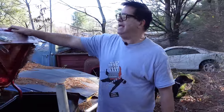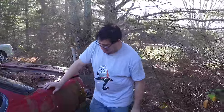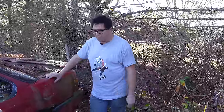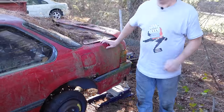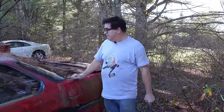The four-wheel steer was an extra-cost option, and about 30% of all Prelude buyers took it. Here we have it on this 1989 Prelude SI four-wheel steer. These Preludes are getting to be pretty collectible. Four-wheel disc brakes on all of them — sporty little cars, strictly two-doors. The Prelude was sort of a smaller version of the Accord, but a great little car in many ways. This one has probably seen its last days — it's a New England car with some rust — but the entire four-wheel steer system is still here. Maybe on a future video we'll put this thing on its side and take a closer look at how that driveshaft feeds steering inputs from the front rack to the rear rack.